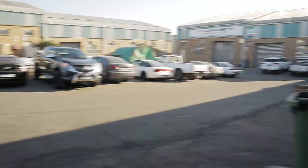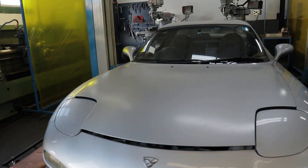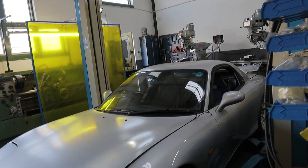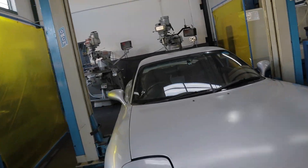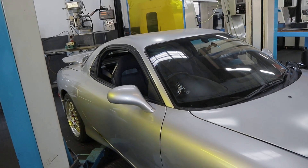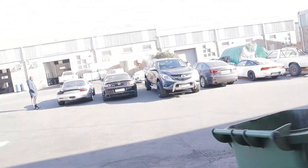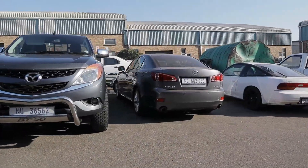We just got Russell's RX-7 and RX-8 out and mine is about to go up on the lift. I'm trying to figure things out. I got the TPS VTA voltages back to what they were — apparently they were at incorrect voltages. I've got my laptop here with the FC HAKO sitting on the table. I'm gonna change maps if need be and tinker a little bit to get this car running today. I need to fetch the new spark plugs from the Lexus.